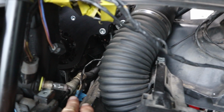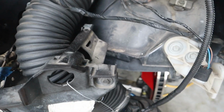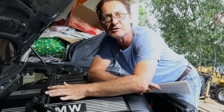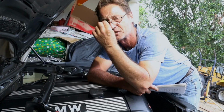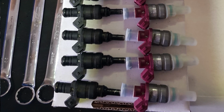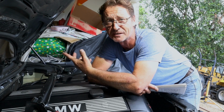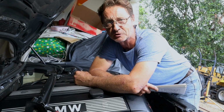Once I get the headlight assembly in and all the brake duct back in there, then I'll finalise my position there. Now also as part of the kit you get new spark plugs, which I guess are a high temp spark plug. Clips for the injectors, particularly if they've never been removed before, can be a little bit fiddly to get out. But a bit of lube when you reinstall them and things like that make the injector replacement quite an easy process.